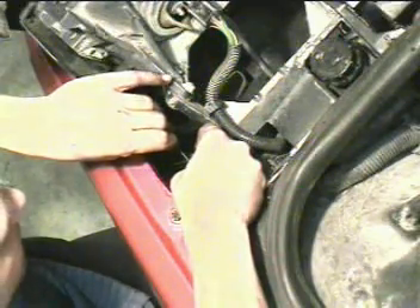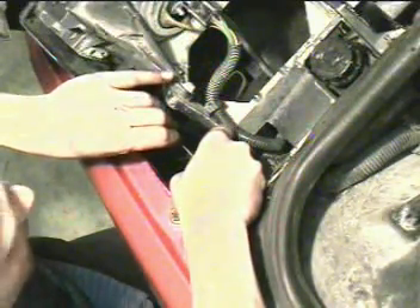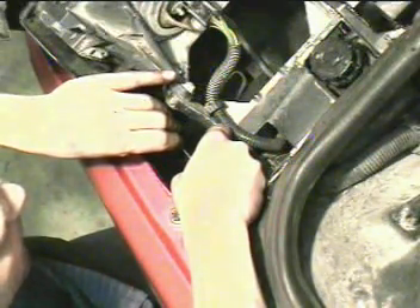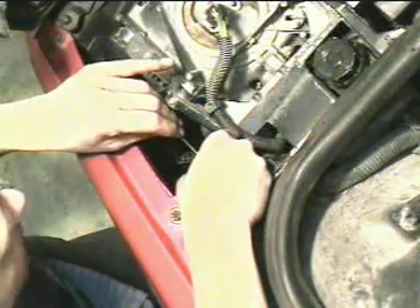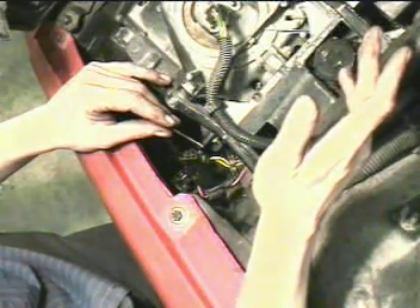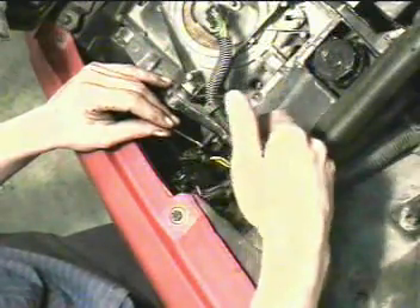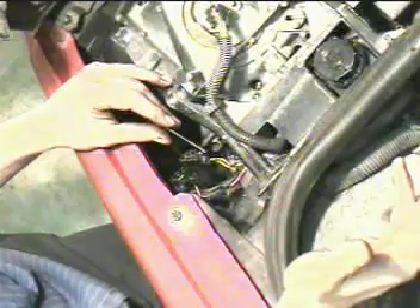There went the right side. Now I'm going to make the left side go down by jumping from the white wire over to the solid blue wire. Both of my motors went up when I jumped over to the pink wire. Both of my motors went down when I touched the corresponding blue wires. So I've passed this test up to this point.